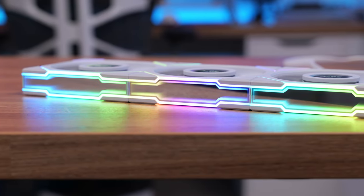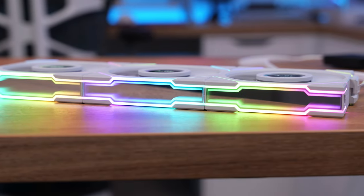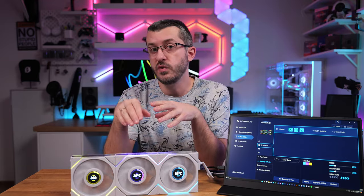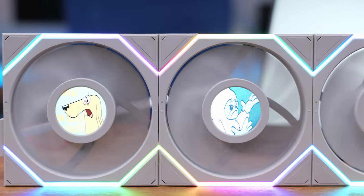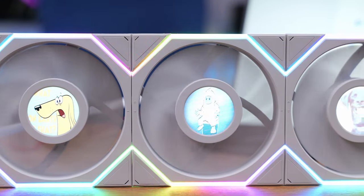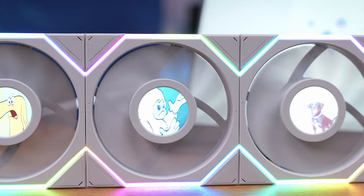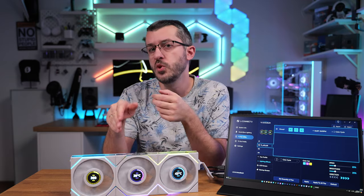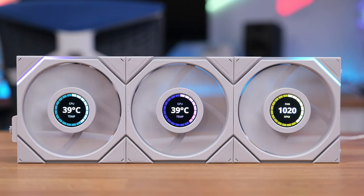The RGB on the TL LCD is the same as on the regular TL fans — an infinity mirror with 26 LEDs in two zones of 13 each. You can display JPEG or PNG static images on the screens, dynamic GIF images, or MP4 videos. Each LCD screen in a cluster can be separately controlled or synced together. The sensor options are a highlight — you can display CPU or GPU temperature, load, and fan RPM, each customizable with two styles and different color choices.